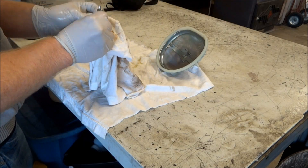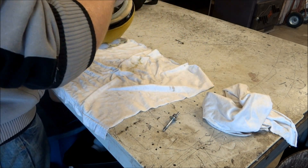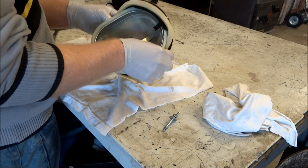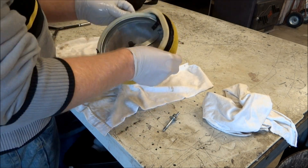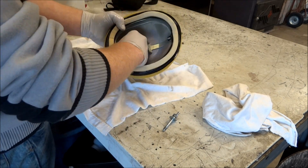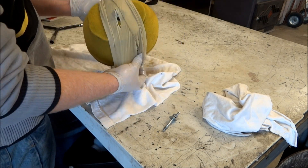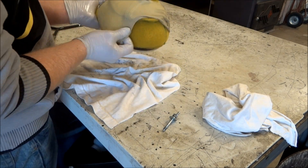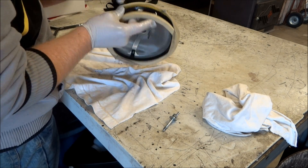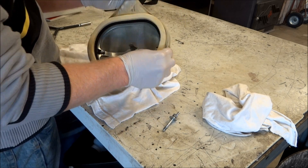It's also a good idea to wipe down the filter bolt and get that clean. Now we're ready to put the filter back on the filter cage. Line up the center hole and the two tabs that need to be lined up, and work the lip all the way around until it's on. For filter skins, I poke a hole in the middle and put it on while the filter is off the bike — it works a lot better that way.